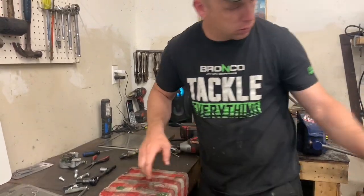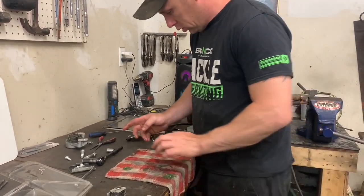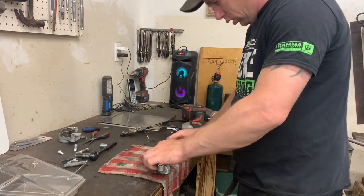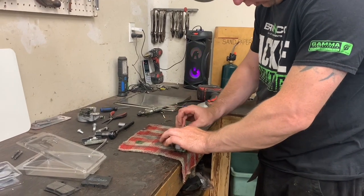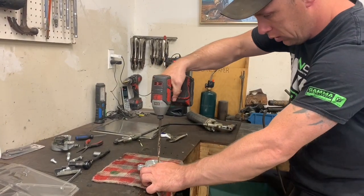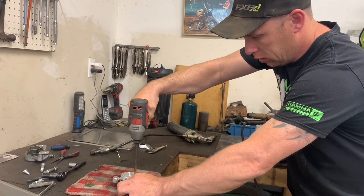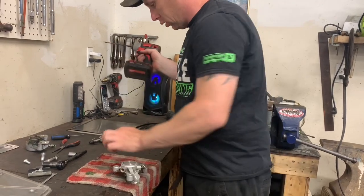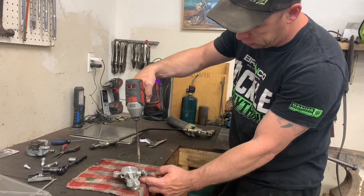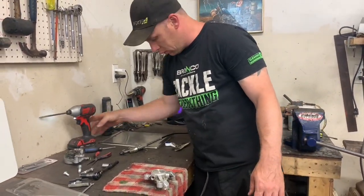Problem is when you let off to do the next pump on the brakes there, you lost some pressure. Right. So you never, this just keeps as hard as you can squeeze it. Most bikes from the 90s or early 2000s even now need this done. Just that time of their life, basically? Yeah. You know, this one, calipers are probably $700 each or something crazy like that. But a lot of bikes, they're reasonable.